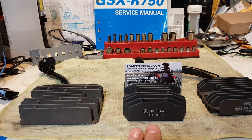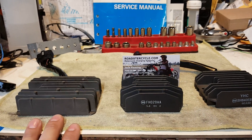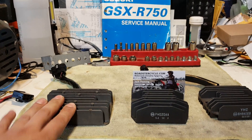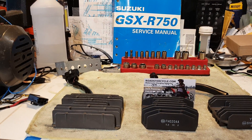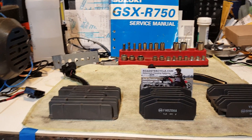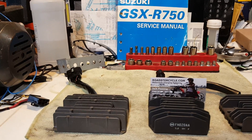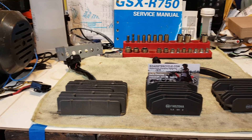I've been experiencing some issues with my regulator rectifier — my battery is not being charged at the 14.5 to 14.7 volts it should be. Right now I'm only getting about 13.2 volts when I rev the bike up to 5,000 RPMs. To test your regulator rectifier, just slap your voltage meter on the positive and negative terminals of the battery, start the bike, crank it up to about 5,000 RPMs, and you should see 14.5 or 14.7 volts across the meter.